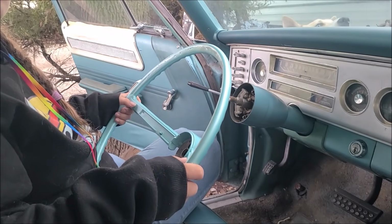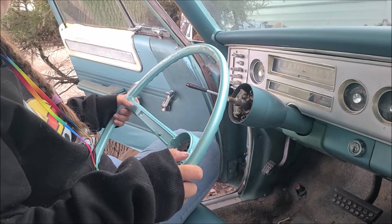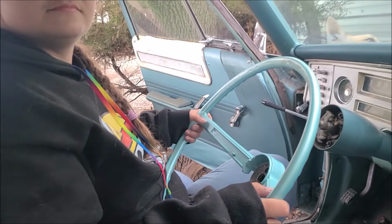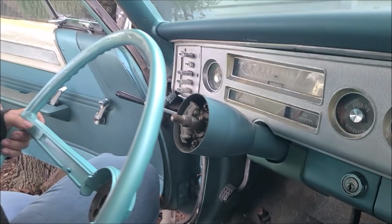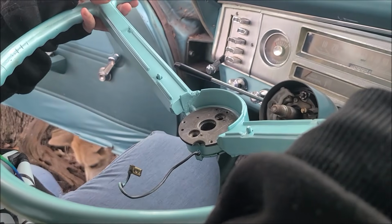So that paint job ought to be really good, and every bit of that epoxy should be plenty hard, right? Yeah. All right, so the first step in attaching this, and this is actually what we've been waiting on, is me having a little bit of free time. I'm a horrible boyfriend, sorry, Anna. It's okay. But the first step is there's a blind spline you've got to line up, and I already got it on the top side here on the steering column. You see that blind spline, the wider one? Mm-hmm. There is a corresponding spline inside.